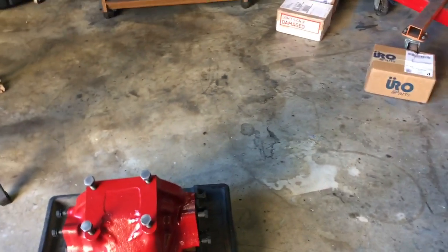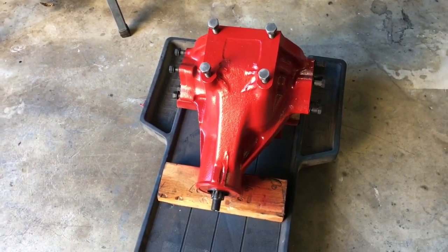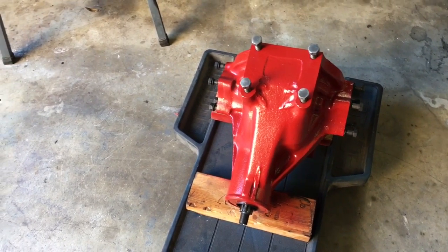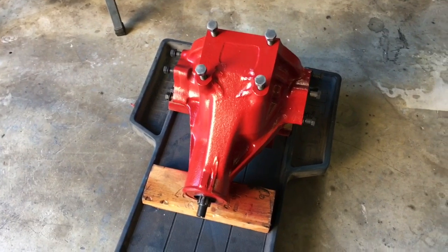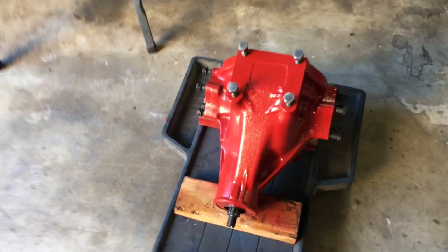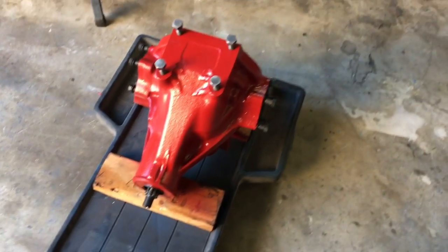I've got my old ones soaking, but they're kind of corroded, so I will probably see about getting some brake line and a flaring kit at the auto parts store. It doesn't use British pipe thread, it uses SAE, so we should be good on that.